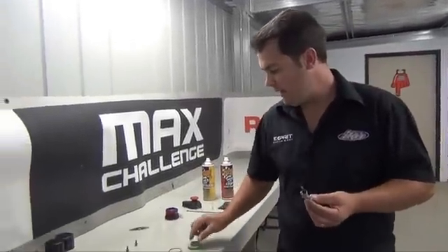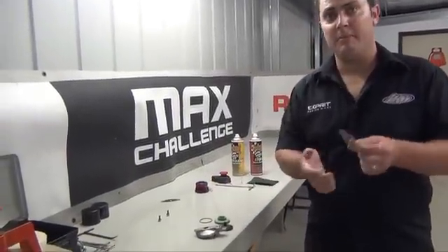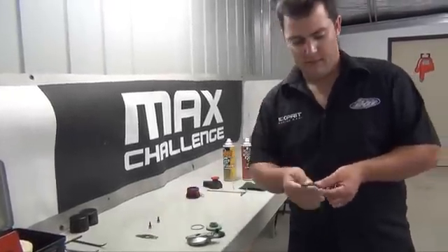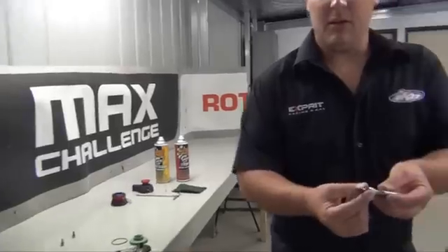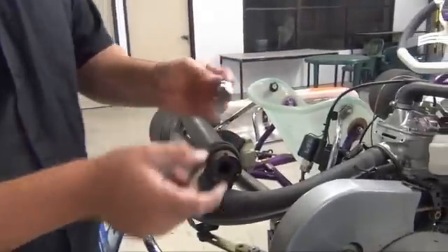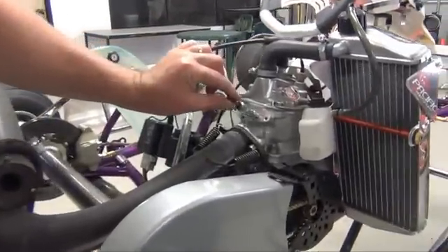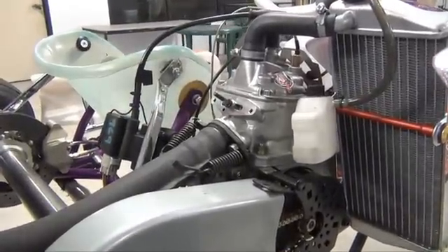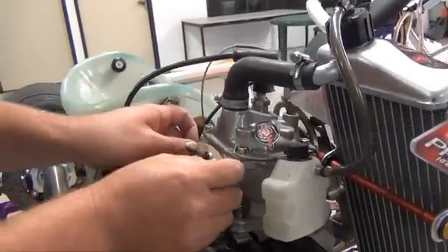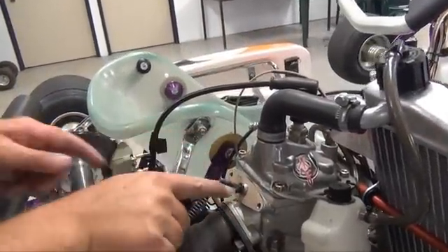Now that we've cleaned the bellows, the blade, and the housing, I'm going to be replacing my gasket only because mine's slightly worn from previous use. You can see how you're going to remove the hose. Replace the o-ring on the top of the blade. Insert with the chamfer face down. Place your gasket on so the holes line up at the bottom.